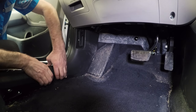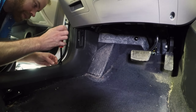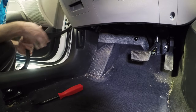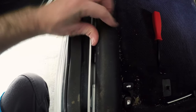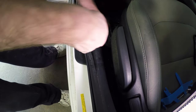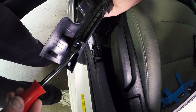Let's start with the Hyundai. Here's the sill panel. Inspect around to see how it's constructed and how it's fastened. I use both hands and pull a little bit just to see where the pressure is. I start checking out the edges with my panel pop tool. I see there are no screws, and I see that the weather stripping is over the panel. So to get the panel out, I have to first pull off the weather stripping. This isn't true in every car, but I found this out just by inspecting carefully before just pulling on things. I can see in the gap where the clips are, so I fit my panel pop tool and pull directly where the fastener clips are. The plastic is reinforced there, so it won't bend. Pull right where the clip is — it's strong and meant to be pried upon there.